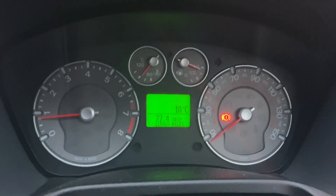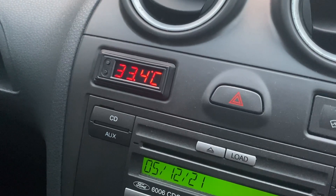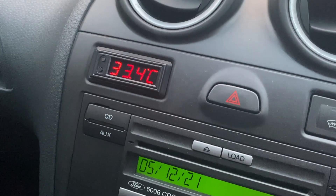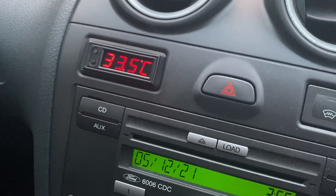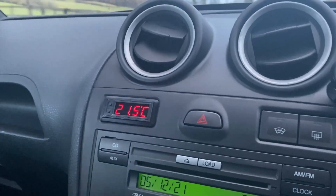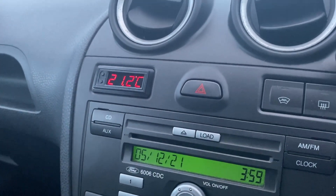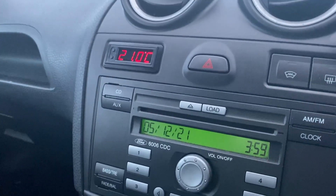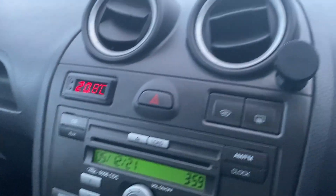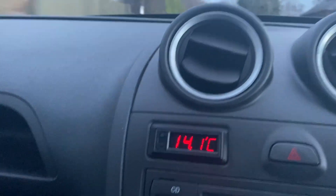It's been about five minutes and the car is pretty much up to temperature coolant-wise. On the intake we've got just over 33 degrees - it's still climbing slightly. Let's go for a drive and see if that gets any cooler as cold air comes into the front of the car. Travelling through a 30 limit the temperature is already a lot cooler, and travelling at around 60 miles an hour gets it even lower. Let's get back and install that air ducting.